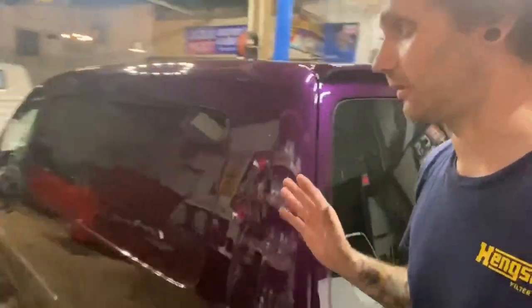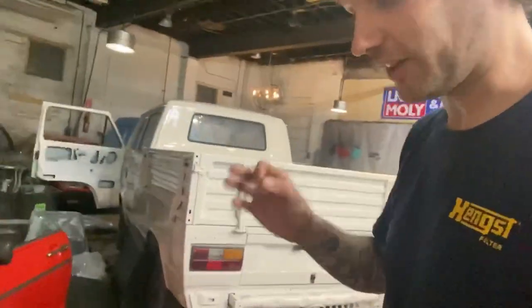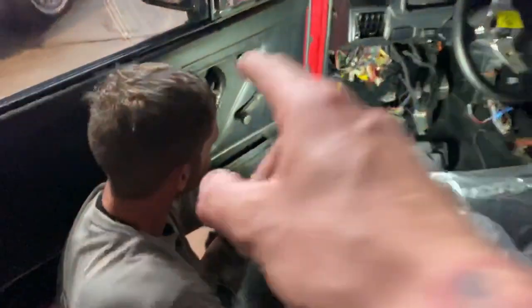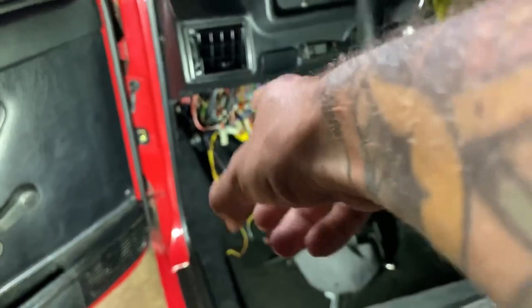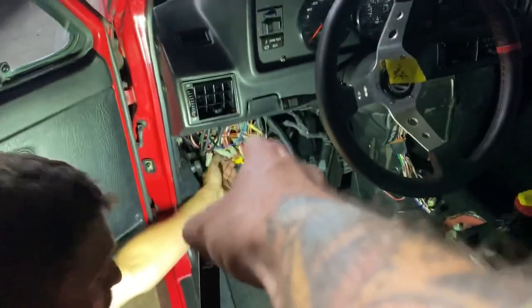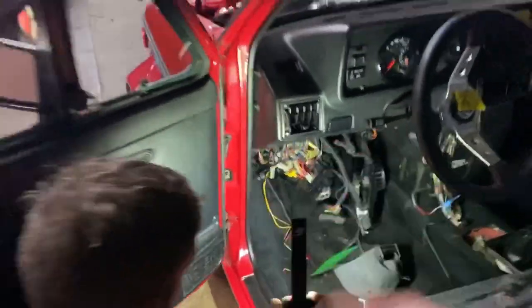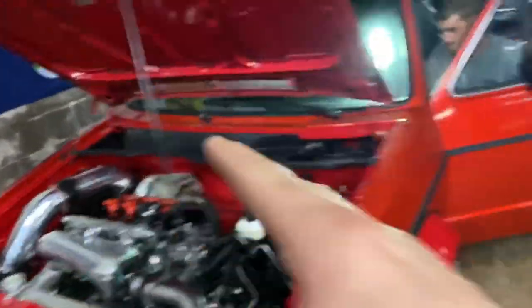Over here, past the hand-built caddy — that's another project for another day — Brandon's cabrio has cooling fans running because it's really hot and humid in here. He's trying to make his cooling fan switch work. Here is Brandon, go follow him on Instagram, and here is a CE1 fuse panel. We found out block C is the one that controls it — wire C20, fuse 15. The wire from C20 goes through C15, which is the fan after-run switch, which then goes out into his now very swapped engine. There's the relay for the custom fan, and that will fix that.